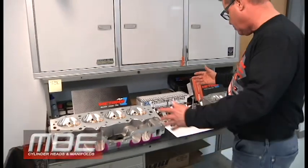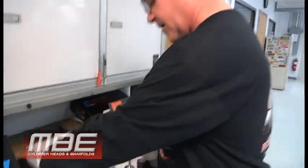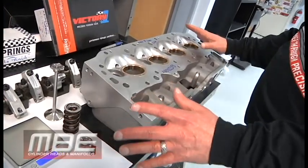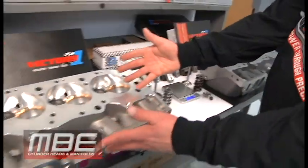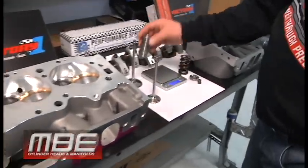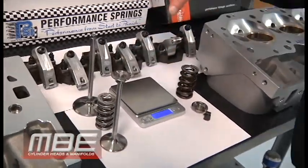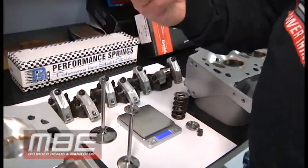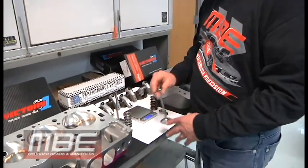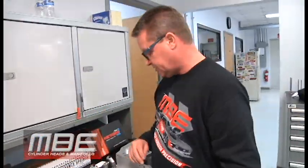So just wanted to go over everything — we look at everything. We got the one-piece rocker bar, 18 fasteners for the 18-degree conventional, saltwater guys with anodized cylinder heads — not a big deal, we can accomplish all of that. Then we have the finished freshwater set, rocker gear, and all this fancy valve train. All of this does not cost any more. The springs you're looking at are about $200 more a set — $200 and last two to three times longer. That's kind of a no-brainer. The locks cost the same, the retainers cost the same, so the upgrade cost-wise is zero. It's just knowing to go to the right people that'll take care of and look out for your application like it's theirs. And that's what we do here. Thank you for joining us — have a good day.